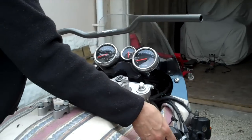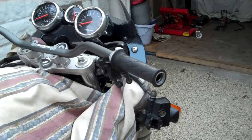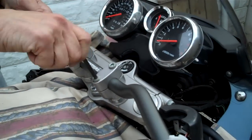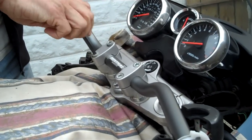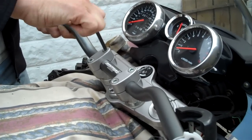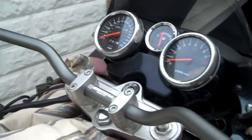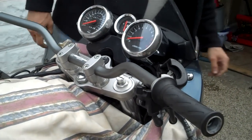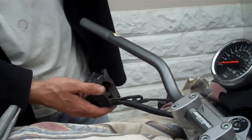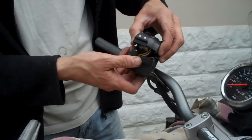Reassembly is pretty much the opposite of disassembly. Slide that collar in first — no lubricant needed, it's plastic against alloy. Pop the clamps on. Don't need to do these up too tight because Renthals are alloy with a textured finish, whereas the stock bars have that knurling inside, so you don't have to beat them up. Now, there are location holes in the top of the standard bars drilled by the factory for the switch gear to locate into — it's really just to stop them rotating. These switch blocks are plastic and they'll just slip round — you can't wind them up like the old alloy ones from the eighties.